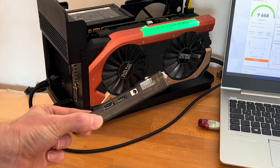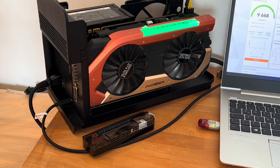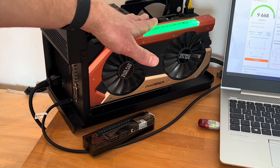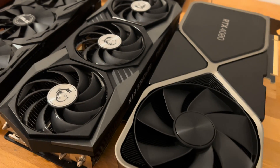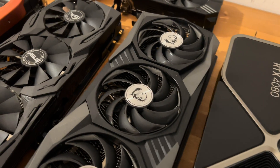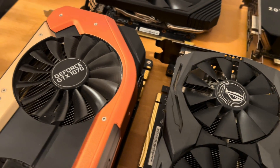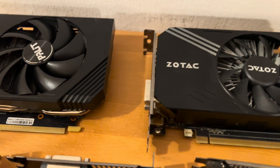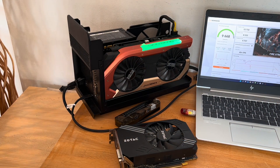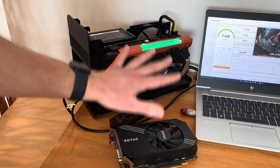Unfortunately I can't say whether and how well AMD cards work, as I wasn't able to test any. If you want to use a more modern graphics card you definitely have to use the USB-C variant, where all current graphics cards and the latest drivers work. I tested an RTX 4080, 3080, 3060, 2060, and a GTX 1080 Ti, 1070, and 1060 in different benchmarks and games. The GTX 1060 and 1070 are the only two cards that work with both the GDC module and the USB-C module, so I tested them in both.